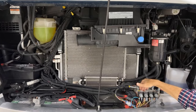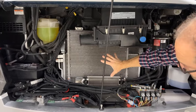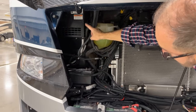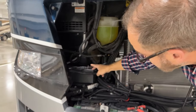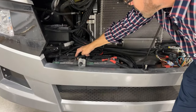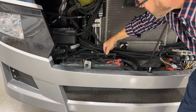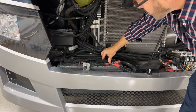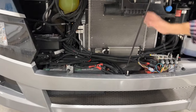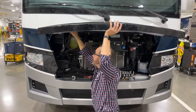This is your engine coolant and your HVAC for heating and cooling in the cockpit area, along with your chassis battery and house batteries. The level of fluid or acid in these needs to stay above the plates, so you can remove these caps and check the fluid level regularly. After you add distilled water if needed to get at least to the above-plate level, lock them back into place. To close the hood, just lift up and reinsert the prop rod in the clasp and close.